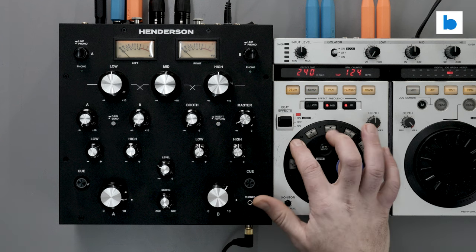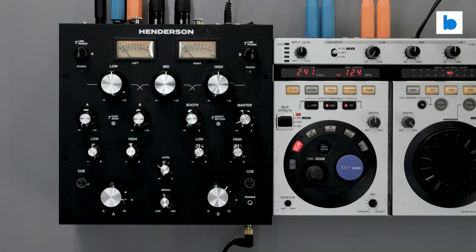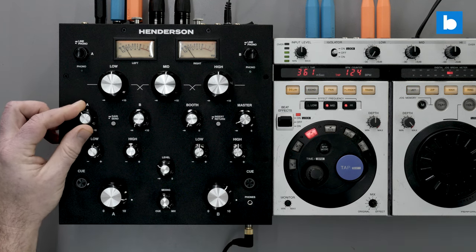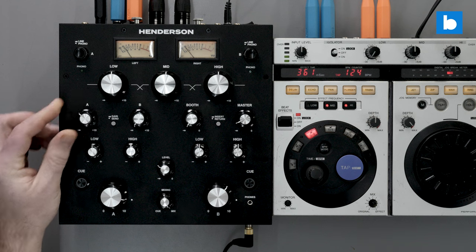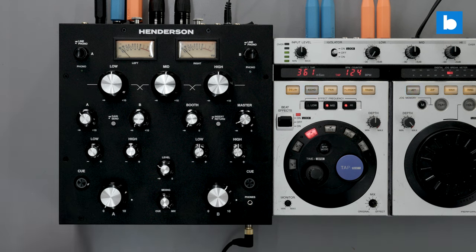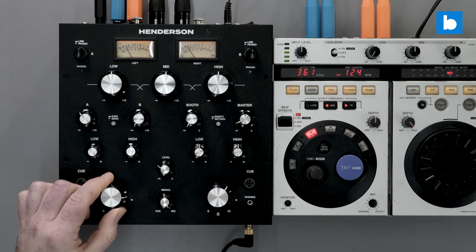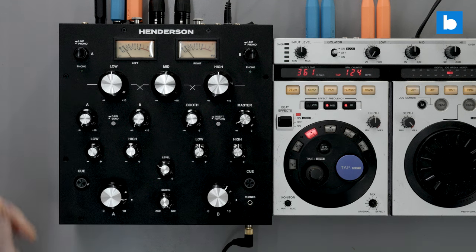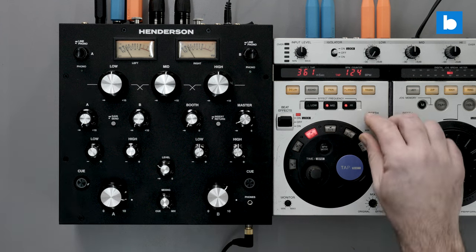It does work great. I hooked up my trusty old EFX 500 and got some great results, which you'll hear shortly. There is lots and lots of headroom on the send controls, so almost any effects unit can be accommodated. And with the third generation, the Model X now has an additional option to switch the effects over to a master insert, making it usable with even more hardware. So yes, personally, I'd always prefer a post-fader option, but for the average Model X buyer, there is nothing to complain about here.